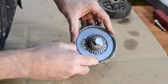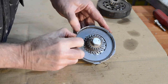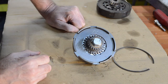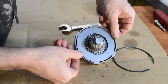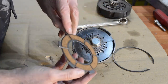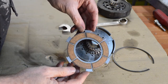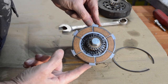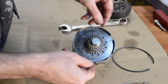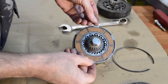There's a large circlip which is held in a groove around there. We'll find the edges of that and hook it out. Then we have our first plate which is a bit tight on this — they've been sitting for a long time. But that's in good nick. This is the LML one, so no wonder it's in good nick — it is in fact brand new. There's a top plate with the corks, and a metal plate, and a double-sided cork.